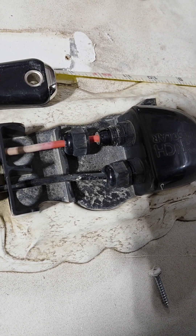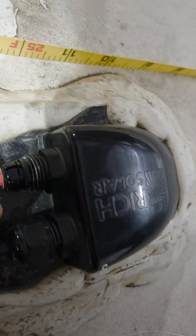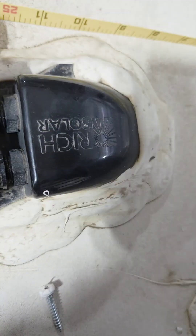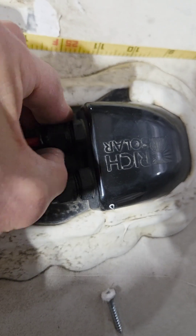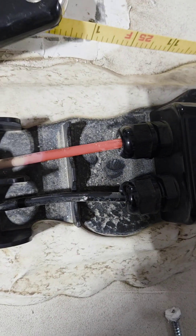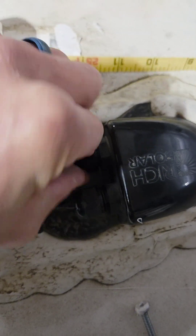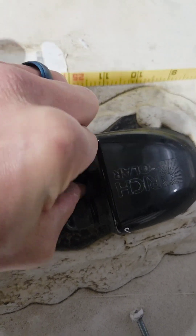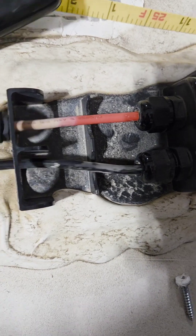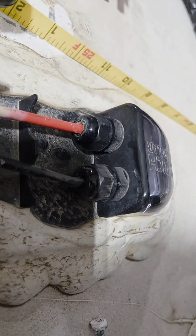This is not extremely well waterproofed. There's a rubber gasket here, and when this is tightened down properly it should seal — but it was not tight at all, you can move it around easily. That is not waterproof, so there could be water damage problems.